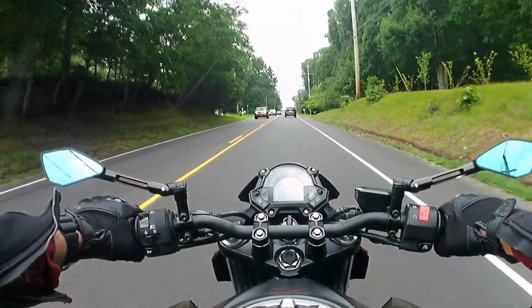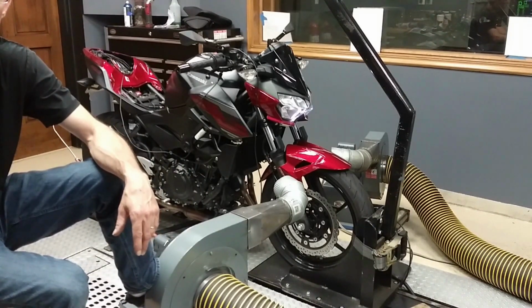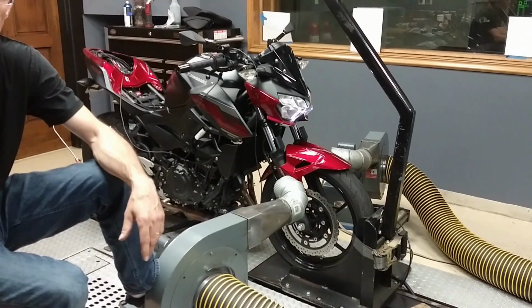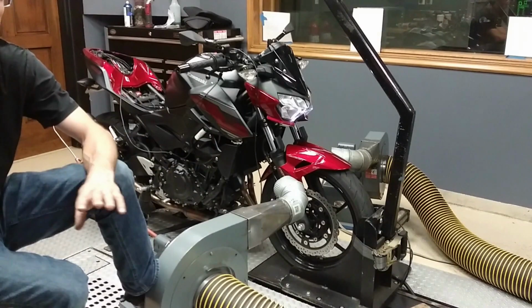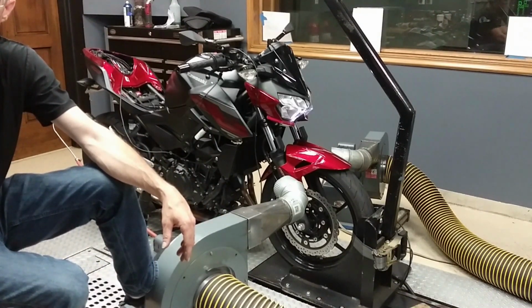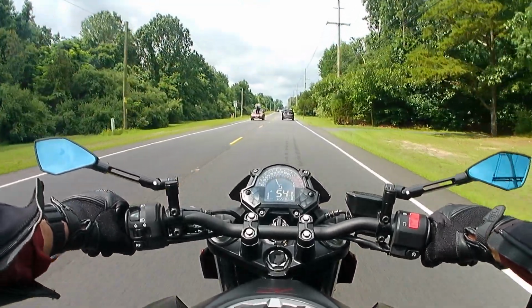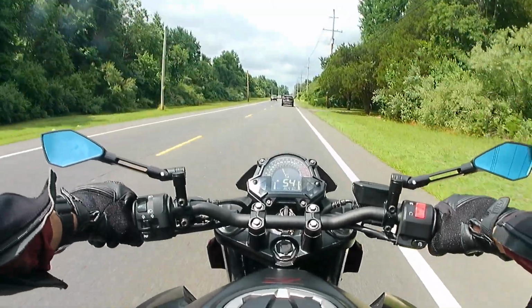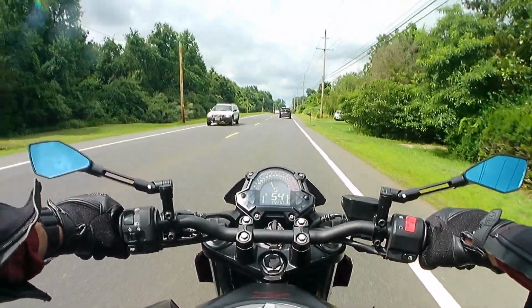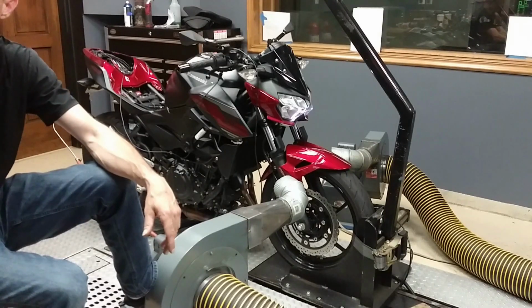When I release the throttle, it sees the RPM drop. It records the data here: at 3,000, this was the miles an hour, the horsepower, and the torque. And these were the carbon monoxide, hydrocarbons, and carbon dioxide that were coming out of the exhaust. So it records that session of 3,000 testing. It also automatically moves the next target to 3,500. I'm going to jump right back in at 10% throttle, now testing this box. Same scenario: I hold it, get a good reading, let go of the gas, then we move on to 4,000 and all the way down.